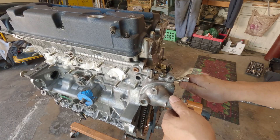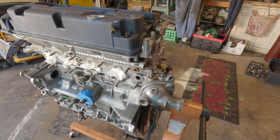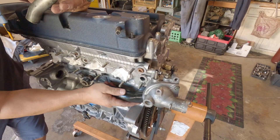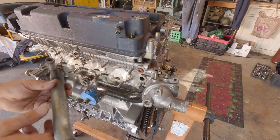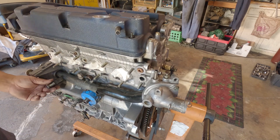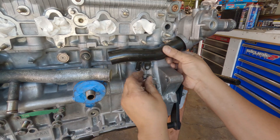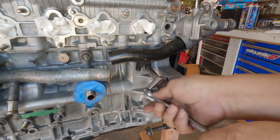I'm going to put the thermostat housing on so I have the precise alignment of the tubing. I install the o-ring for the thermostat housing side because I want to make sure everything is correct. For this side it has a stopper on there so I can just put it on. All I need to do is put the mounting bolts in and just pull it out just a little bit to secure it in place.